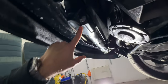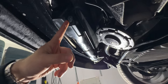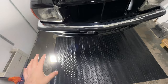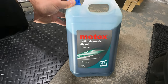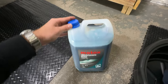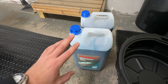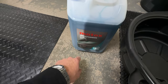Here we have this radiator. I think I'm going to drain it from this plug because I'm pretty sure it's not going to make such a big mess from here. I try to keep everything as clean and nice as possible. So the coolant we are going to use is this G11. I think this should be kind of like the original that they used. You need to mix this with water — 5 liters of this plus 5 liters of water — then you will have a coolant that's good for minus 36 degrees.